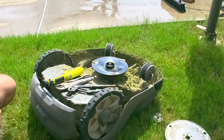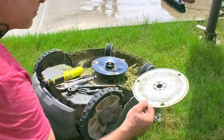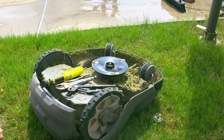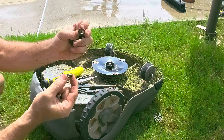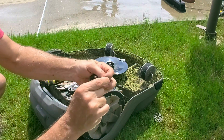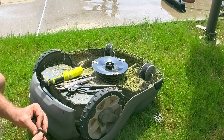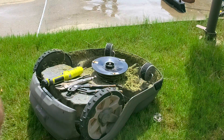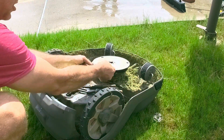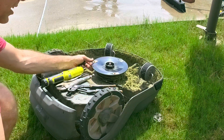These are the bearings that allow the friction disc to spin freely. One of the bearings had frozen up — one bearing was still looking okay, but the other bearing was completely frozen. So I was getting a fault telling me a blade fault error. So if you're getting a blade fault error, check and see that your friction disc is spinning free of the actual blade disc.